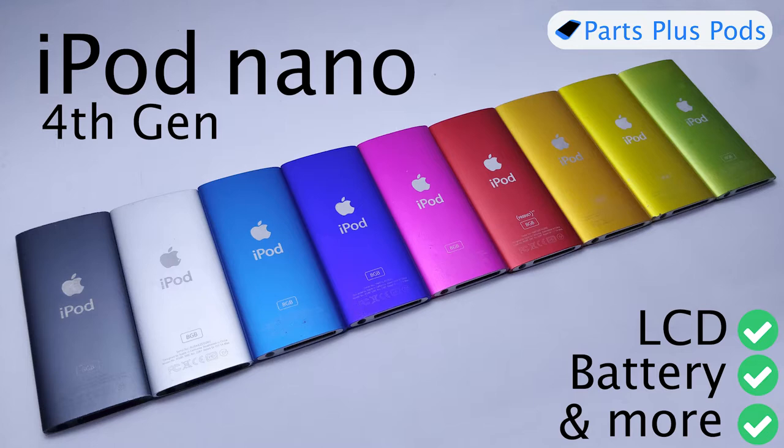Before we get started, I just want to say this iPod is basically not fixable unless it's anything further than a battery replacement. There are so many issues with the buttons and the logic board failing, and the flex cables fused into the PCB being corroded, and if that happens, it's just unfixable. So before you even get started, just know that if you have anything more than just a battery, you might not actually be able to fix it.